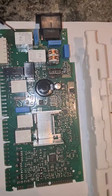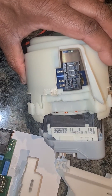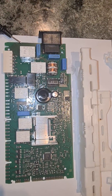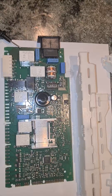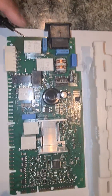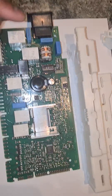So normally it's very quick — with this in situ inside the dishwasher you can take the measurements. But also when you have error 9, always check for any mice inside the dishwasher and check the board as well, because this particular board handles active and neutral to the heating elements.